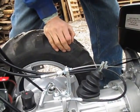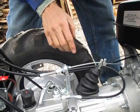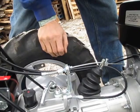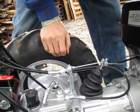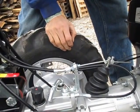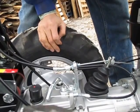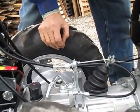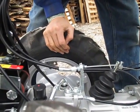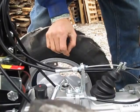This is the neutral position. What happens is as the clutch plate slowly wears and the cable slowly stretches over time, you lose tension on the cable so that when you're pushed down all the way, you just don't have as much force on that clutch plate as you did originally, and the machine may start to slip. You'll have the drive engaged — mowing or tilling — but the machine starts to slow down. The engine doesn't necessarily slow down, but your implements and wheels start slowing down, which tells you power is not being transferred through the clutch.